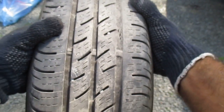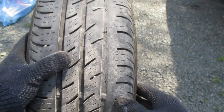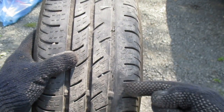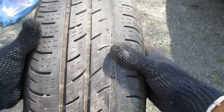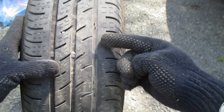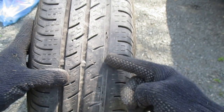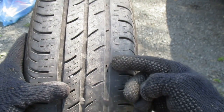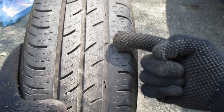As we go further along, we start to see where a belt has busted. We see these lines here, and you can basically follow this around most of the tire. Here where they've really failed, the tire has bulged out and is severely worn because the tire is uneven now because of these broken belts. There's another one - we see it popping through all along here.